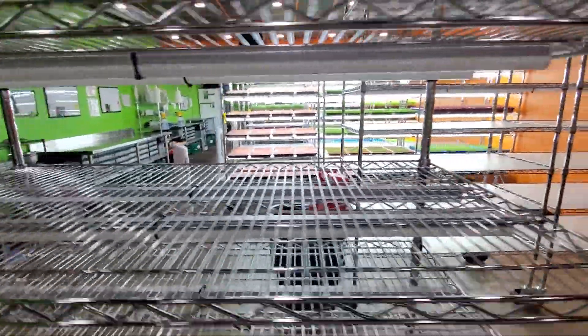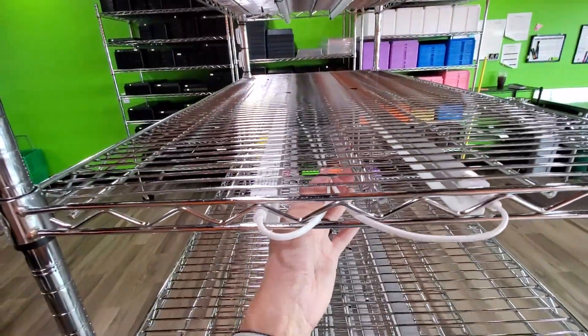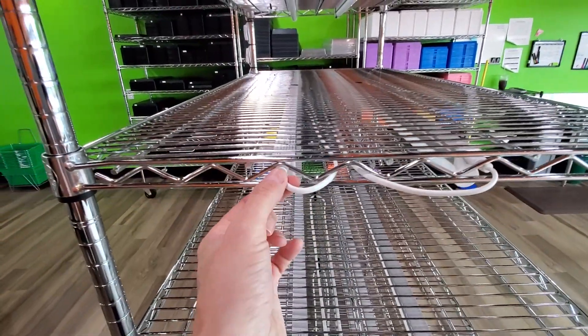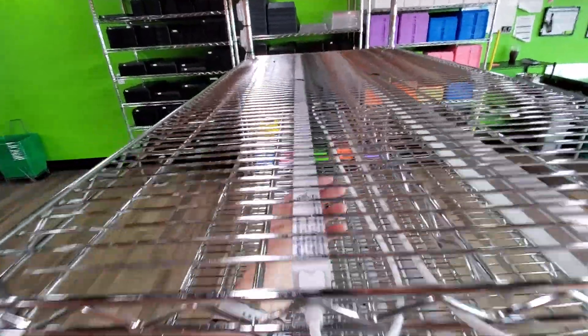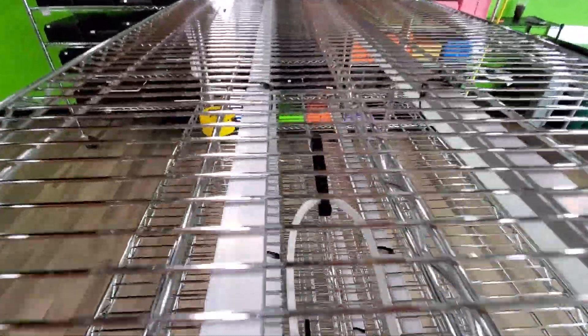There's no wires hanging down, there's no wires anywhere. The opposite end is basically going to be one regular wire and you can see we leave them a little bit loose. If you tighten them too much, you can actually cause the wire to bend too much and it will cause an electrical issue. So leave it a little bit loose — it's not going to hurt anything. It's still out of the way, but we just zip tie it down on that piece as well.